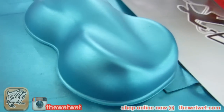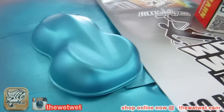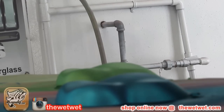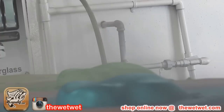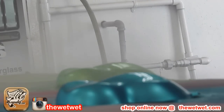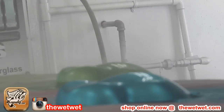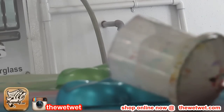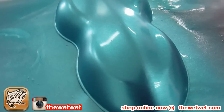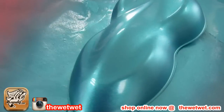This is cocktail flattened. You saw me spray two coats on it. Now we're about to shoot our second coat of the flattened clear. Lay the gun down. Catch it while it's still wet so you can really see the sheen. See how it's glossy? See the sheen, we just shot it. Pretty much, it was a medium wet.